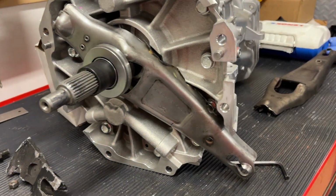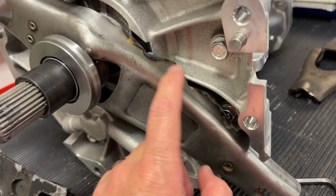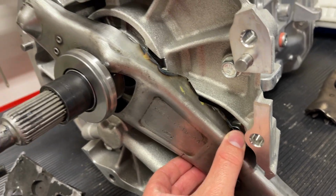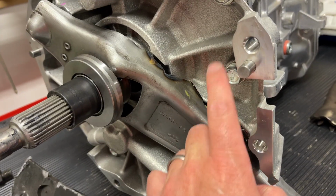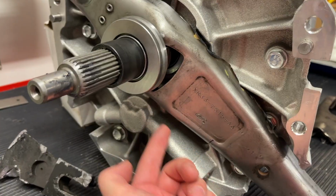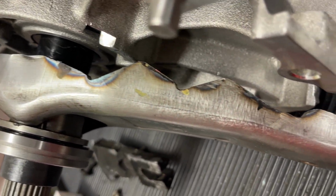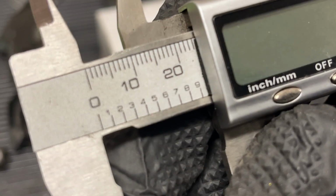Okay, another note on clearancing, even when you're taking this off of the backside here and you're cutting it so it's not hitting the webbing anywhere here, you're always going to be hitting a high point. So you'll grind it down, and then when you put this here, you might be hitting here, so you grind that down. Then the next thing you know, that's making a hit here or the other side. So just know that about the clearancing. You can see what this ended up looking like to get it to miss all the webbing, to miss those bolts, and get it really far back.